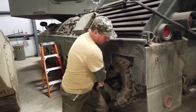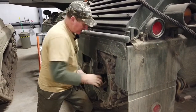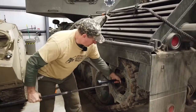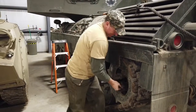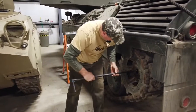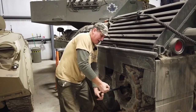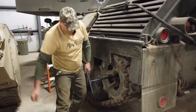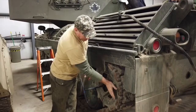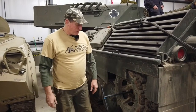Now this one's already been partially done, so we know we're pretty much where we need to be. We just wind her up to the stop, which means she's fully disengaged now. I can take my guide rod out and my lock tool. Just to demonstrate that we are disconnected from the transmission and the coupling is no longer attached, we can test it. I can turn that both ways without the final drive moving, which means the slip coupling is now totally disengaged — it's pulled all the way back, disengaging the final drive, which means we can now pull the engine out free of the final drives without impacting anything.